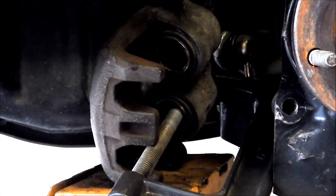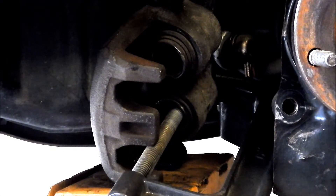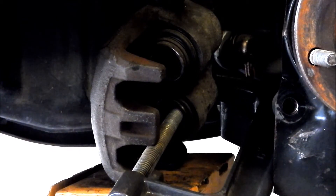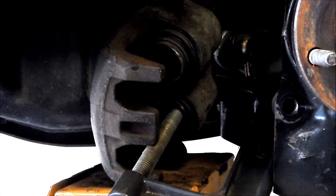I bet it's going to be hard to press now. Okay, there you go — one out. So I mean, I guess it's fine. It seems like the other one moves out more easily and that may be our problem. I'm not sure. If I look at the pads, it looks like they're worn pretty evenly. They look like they're worn evenly. I don't see anything wrong. So honestly, I have no idea what the problem is. I think I'm just going to go ahead and install the new brakes and just make sure I lube up those caliper guides real good.